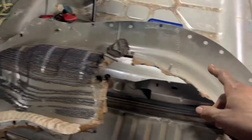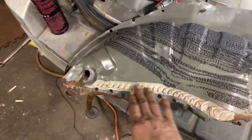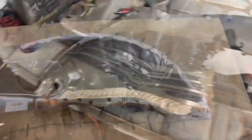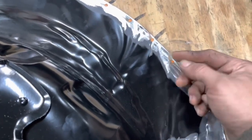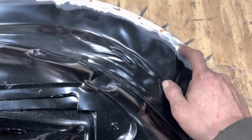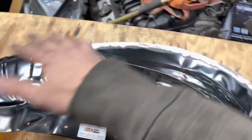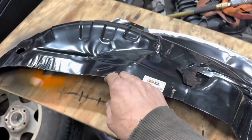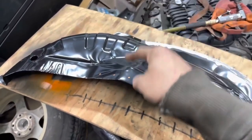This is what it looks like once it's all the way out — and this is why we didn't take time to remove the glue, because it comes out with just a cut. During panel preparation for installation, we mark the holes. We want to keep them as close to the edge as possible because of the overhang of the arch, but down on the bottom this spacing marked right there is good enough. We have to grind down the outside — sanding discs are the best for that — and that allows us to both weld and screw it into place for double durability. Each hole is about one inch apart.